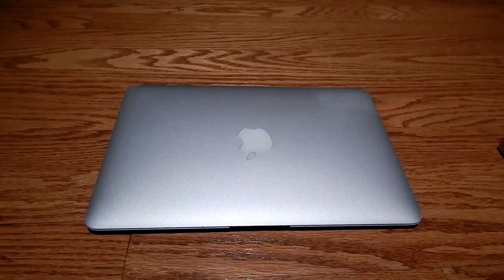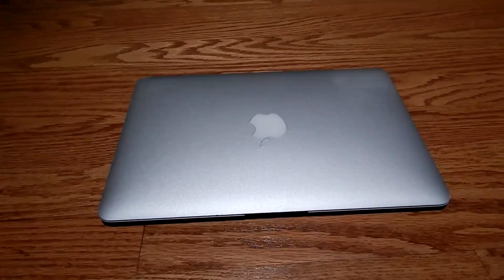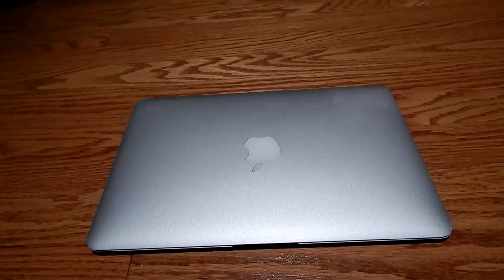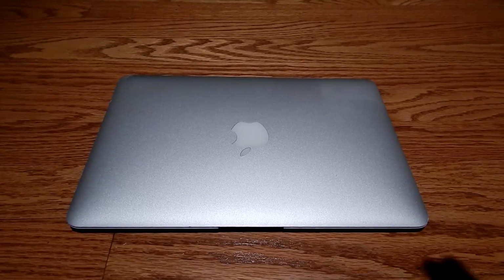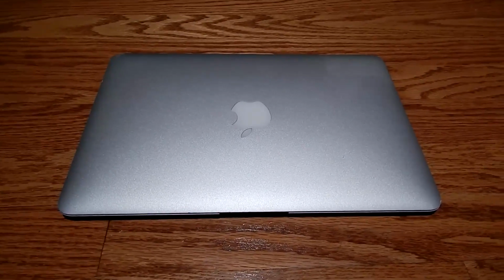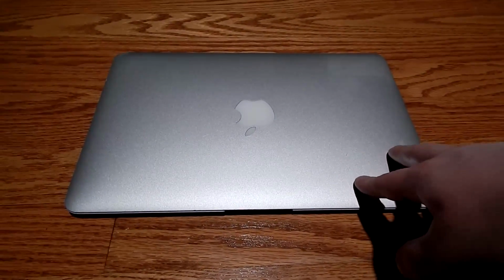I like this machine a lot. It's a great machine. Even if you're not a Mac person and you need to pick one up like I did, I definitely recommend the MacBook Airs. I kind of wish I could have bought a 2011 or 2012 model, though, because the models before the 2013 can take mSATA and M.2 SSDs, I think, respectively. I forget. I think the 2012 model can take M.2. So that would be ideal to get over something like the 2013 model that I have here and beyond, because they use the proprietary SSDs.